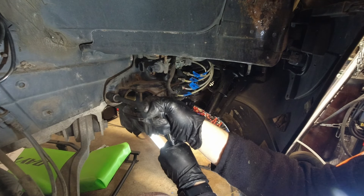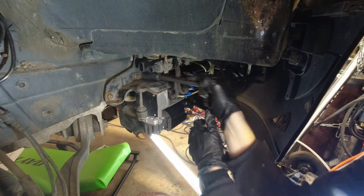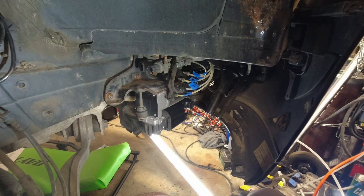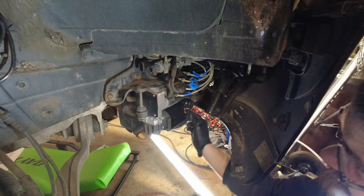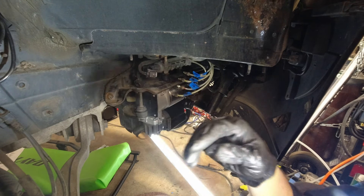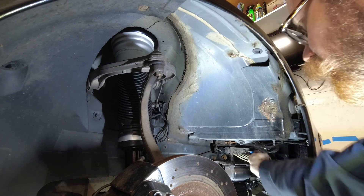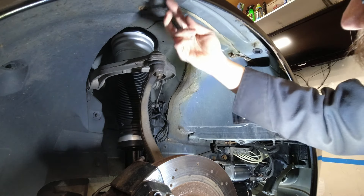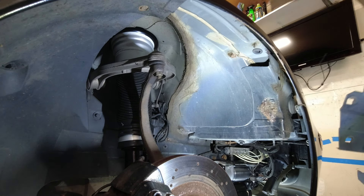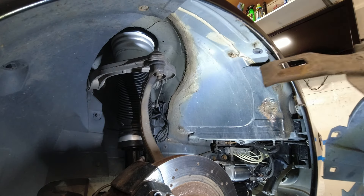I'm going to attach the compressor before putting the bracket back in — unlike last time, that was such a pain. Going just until they're seated; their spec is 2 or 3 Newton-meters, which is very very low. I have this line here that came off with the new valve block, so I'm just going to put that in. I'm going to replace this o-ring — it's a 010. I also realized I forgot to put this bracket on, so that goes here. I didn't find a torque spec for these bolts but they go into the chassis, so pretty tight — but don't overdo it, just snug.